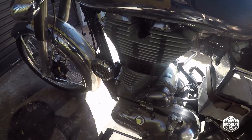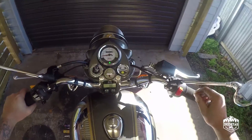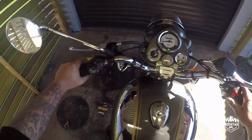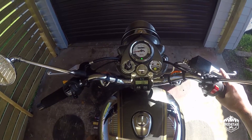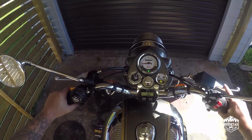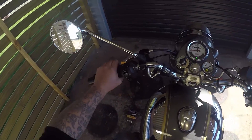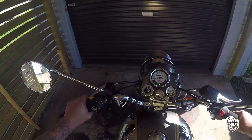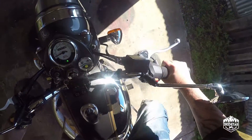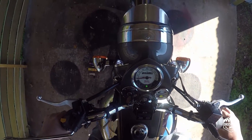Let's jump on and fire it up. I don't normally kickstart the bike — I hate kickstarting bikes — but we'll give it a go. Ignition on, side stand up, kill switch engaged, fuel pump allowed to prime, kick start out, clutch in. A couple of kicks to free up the plates, find top dead centre, then one good kick.